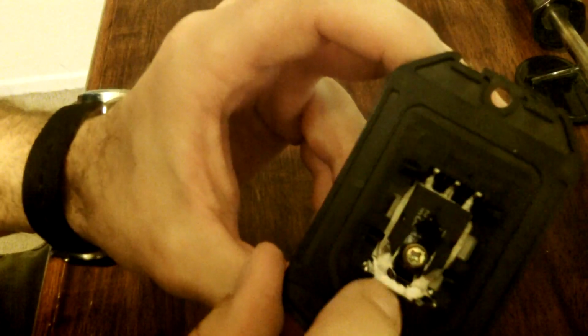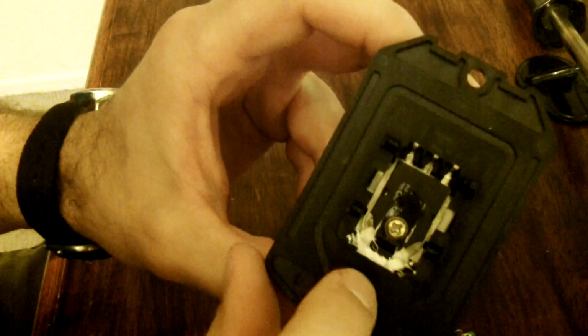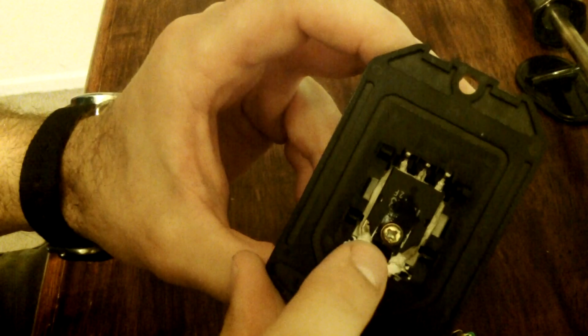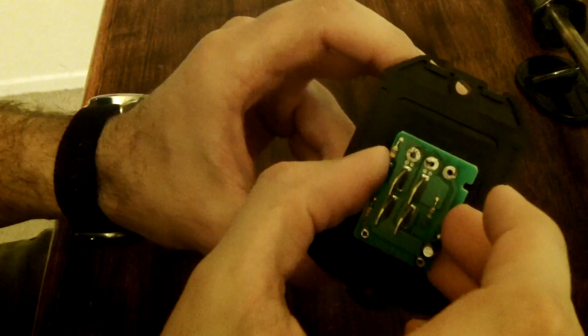And so I took that screw out, which has a holder which holds down the fuse, and pulled out the old fuse, put in the new one, bent it to shape, trimmed it to length, and put heat sink compound around it. Put the holder back in, test it for continuity, and I do have continuity. And now I'm going to solder back on the connector and the board.